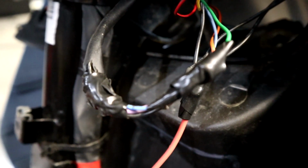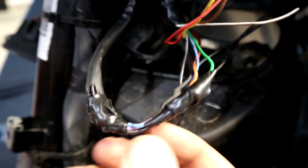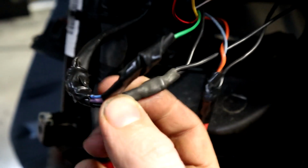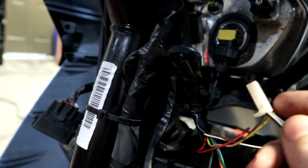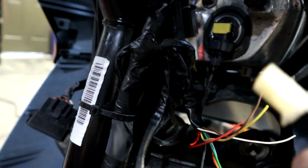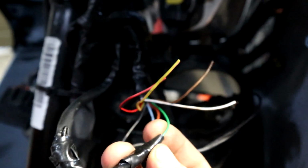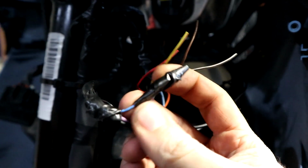So up here, up at the handlebar, the wiring has changed a bit. So there was a ground coming out of here and out of the 3-pin connector, and that is tied into ground. You'll see these 2 leads here that run to this. That actually makes it so I can plug in the city lights in the front of the headlights, because on the North American scooters they are not connected. The green wire, which is the kill switch, runs into this blue lead here.